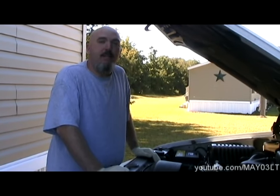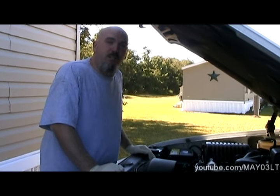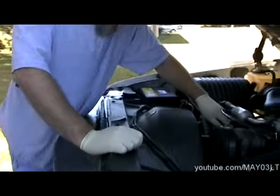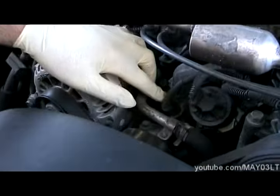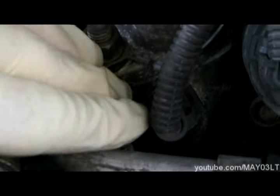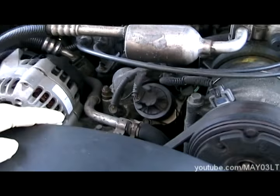So how can we get two different readings from two different sources? A little known fact about this truck: we have two coolant temperature sensors. Right here by the thermostat housing is the one that everyone says, oh, there's your coolant temperature sensor, and they think that's the only one. This one is noted because it has two wires coming out of it, a yellow and a black.